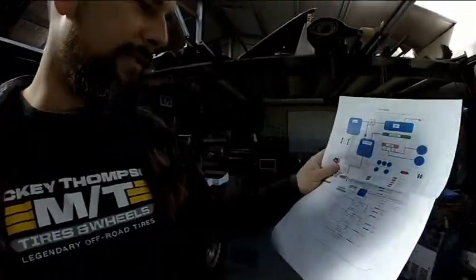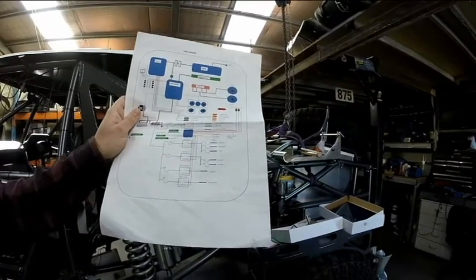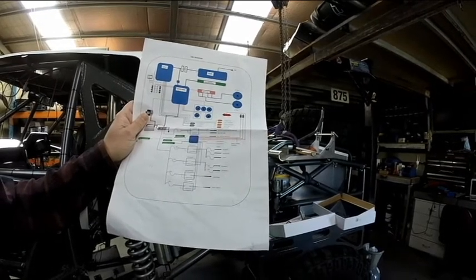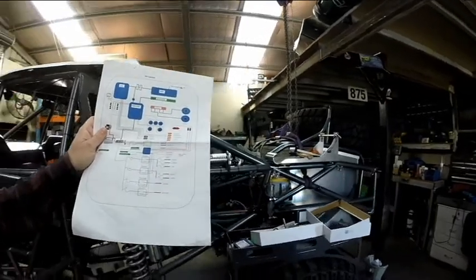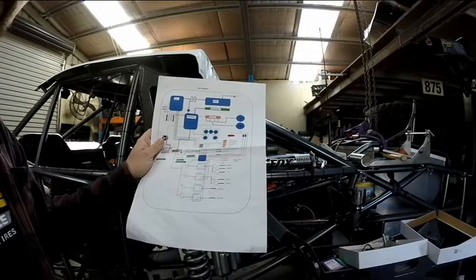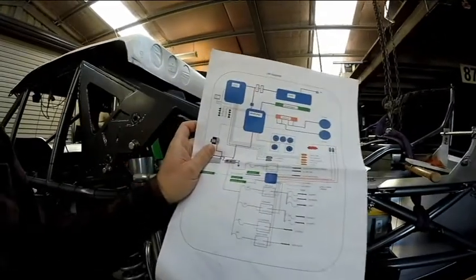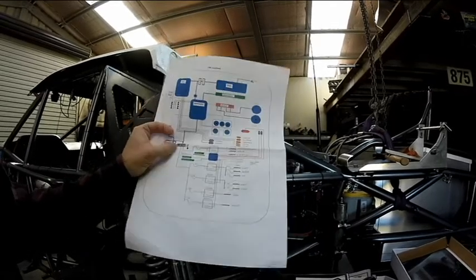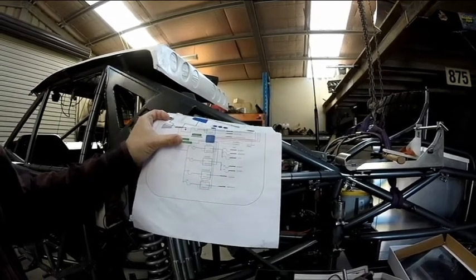All of my ancillary relays I had actually wired. I don't know if you're going to be able to see this, but I basically wired them all back to the smart wire as a switched ground. So even though it's a switched ground, it's not an input, it's an output. So I needed the smart wire to output a ground to the accessory relay, the blower relay, all those relays down there, because I just jump it off the main feed to the coil side with the 12 volt.